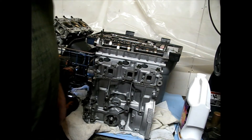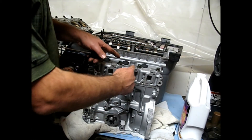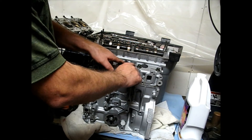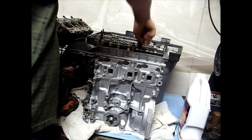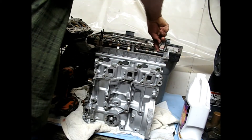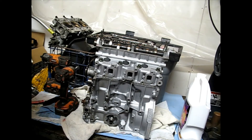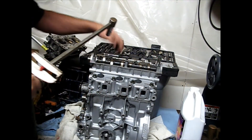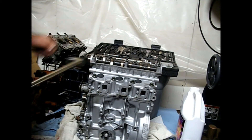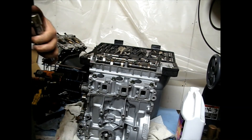General rule of thumb — if you're ever without a book, you shouldn't be; always get a torque spec book. Generally start from the center and work your way outward when tightening, so you take out the slack from the center out. I'm going to bring these up to 20 foot-pounds, then 40, then 54.